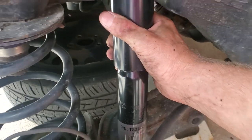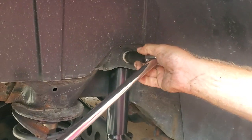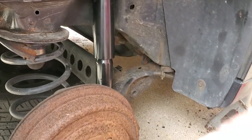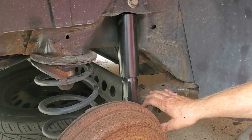You can see where the bushing is — and that's it, guys. That's really pretty much it. The only other thing I'll do with the one on top is take my breaker bar with the 19. Yeah, that's not going anywhere — we're totally golden. We don't even need to check the bottom one again because we already know it wasn't spinning at all. And that's it, guys — that's putting a shock on a GM 2008 HHR.